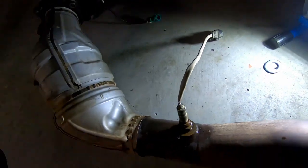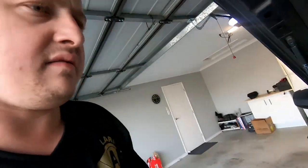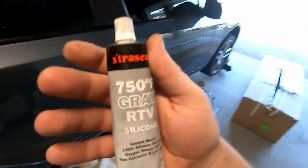We're back — Day 2, Thursday. The dump pipe is in; I don't think I filmed that yesterday but it's been bolted up. I used a bit of exhaust gasket sealant — you can also buy that at Muffler Madness. It just helps supplement the gaskets. The gasket that comes off the dump pipe is pretty small, so just put a smear on it and wipe off the excess so it doesn't get anywhere you don't want it.